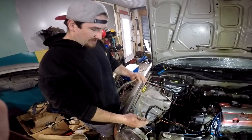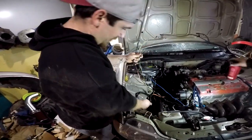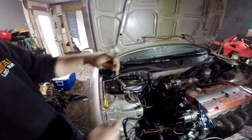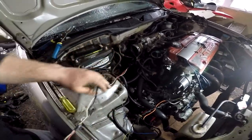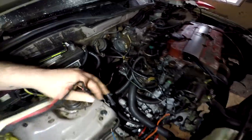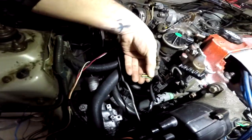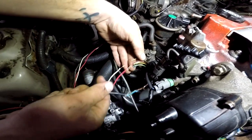So we got all the wiring harness out of the A4 harness. We got the two plugs in the distributor and it all ties into your exterior coil. I got the crank sensor down there plugged in. We ran it down behind the engine away from the axles and all that. Can't really see that on those cars. This is a Y7 distributor harness right here. We gotta cut all in, and they're all color matched. Boom, boom, boom, boom, boom.